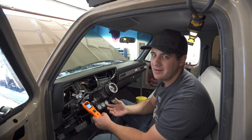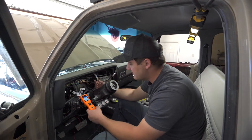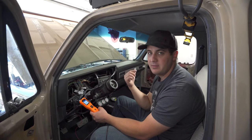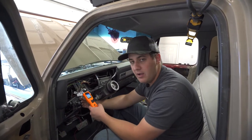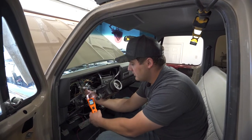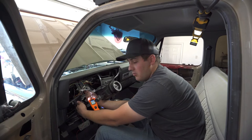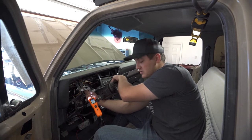These gauges aren't going to pull crazy power where you need to ground all the way down to the chassis — grounding to the sub dash or the firewall will give you a good enough ground. Next, you're going to need to find some switch power. A nice thing about these gauges is that they don't require both constant and switched power — you just need switch power. They have built-in memory inside that won't erase when the switch turns off or the battery gets disconnected. You're going to poke around on all of your terminals until you find one that with your key on gives you 12 volts power. We've got 13.2 volts here. Make sure that's not constant — turn your key back off and sure enough it switches off. Also make sure it doesn't change with your headlights or your blinkers. There's your good switch power source.